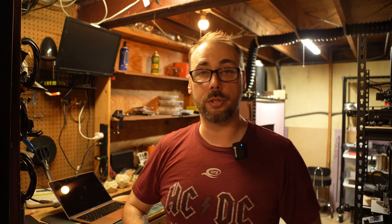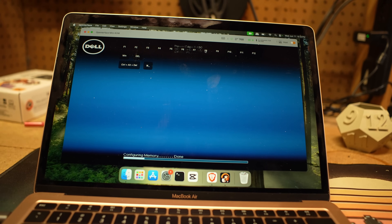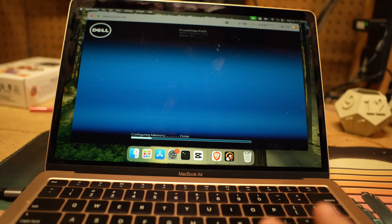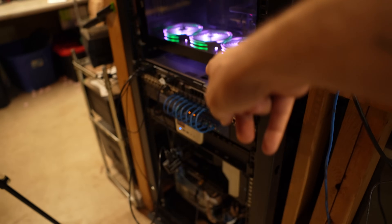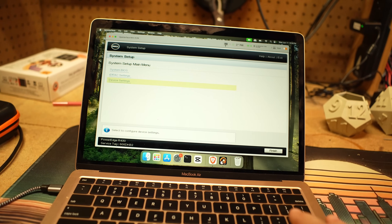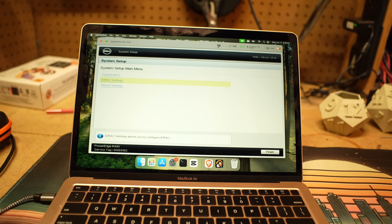Plug in our bright orange cable — two hours later and a little bit of troubleshooting later, it looks like the cable has some kind of intermittent issue with it specifically. I plugged in a separate USB-C cable and it works. So check this out — you can see we've got a dropdown here for all of our function keys, F1 through F12, we've got Control-Alt-Delete and stuff, so if we need to send those keys to the target, we can do that. In their terminology, this is the host and that is the target.